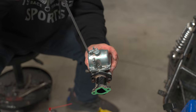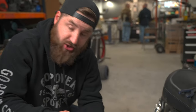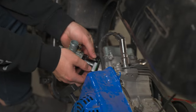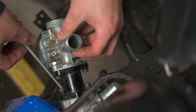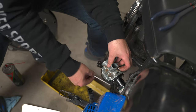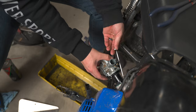Make sure you check your gasket — if there's any kind of rips or tears, just replace it. Cheap insurance. If you're going to be doing some extreme riding, it might be best to put a little bit of blue Loctite on these bolts when you put them back in. Just a little bit — don't put too much, because when you pull it off the next time you could strip out all the threads.